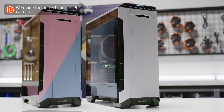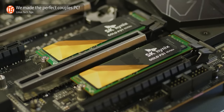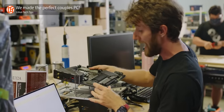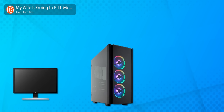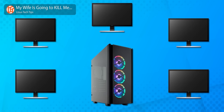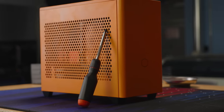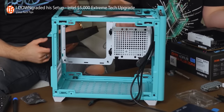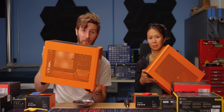We have actually combined his and hers gaming systems before using virtualization. The issue is that the cost advantage of sharing components like the motherboard and power supply ended up being outweighed by the drawback of running up against anti-cheat solutions that will falsely flag virtualization users for cheating. Bringing us to the better solution — a fast, relatively easy mod that allows the Cooler Master NR200P to fit two full-fat gaming rigs.